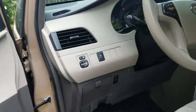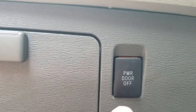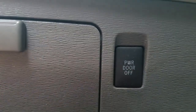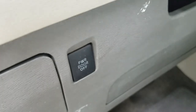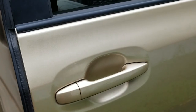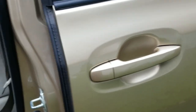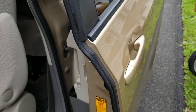The most important thing about working on this 2013 Toyota Sienna is understanding that it has automatic sliding doors. The first thing you're going to want to do is open up the driver's door, and right below that split there's a button to the left side of the steering wheel underneath — it's power door off. Make sure that when you press that button, the automatic sliding doors no longer function. Then, because you're right next to the passenger's or driver's side rear door, just give it a pull and make sure it's manually operated.